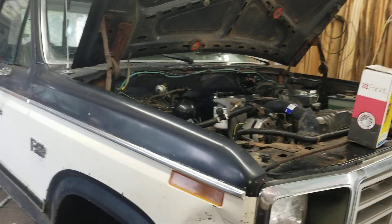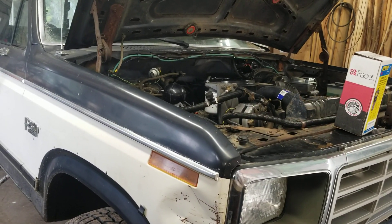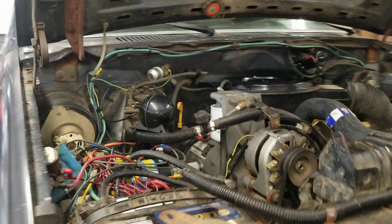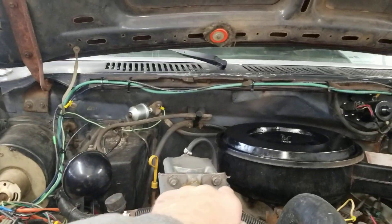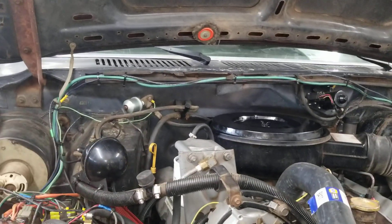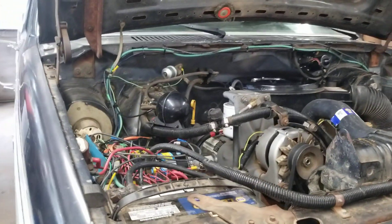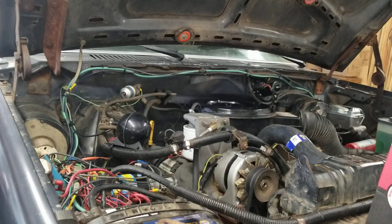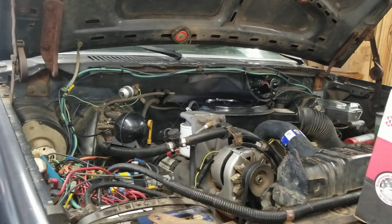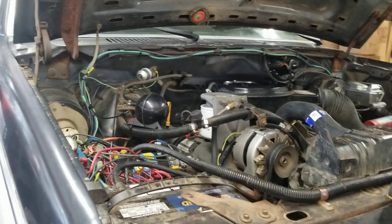When you put an electric fuel pump in, what it does is you can put fuel back in your tank, go in and turn the ignition on, and the fuel pump starts. Come over here and bleed the air off the Schrader valve, and when you see fuel, go in and start the truck — it'll light off instantly. You can take a situation where you've lost fuel from being out of fuel or whatever, to having the system purged and running in under a minute. And that's worth an awful lot to me.